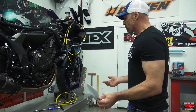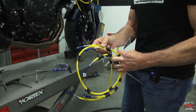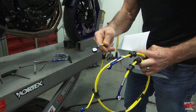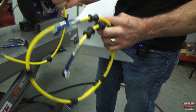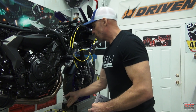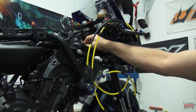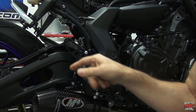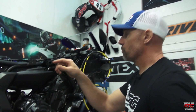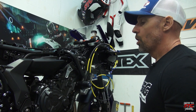These are your brakes and there is zero margin for error — everything has to be done correctly. This is a multi-line kit. We have three lines for the front — I went with yellow and blue again, it's going to look amazing. Spiegler has put stickers on each fitting to denote where it ultimately goes, which is very helpful. The two lines for the rear are going to replace everything from the brake pressure modulator valve and pump assembly to the rear master and to the rear caliper.